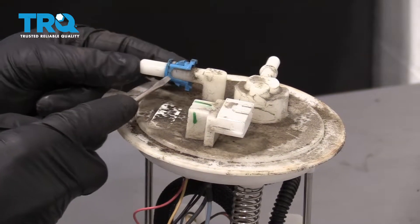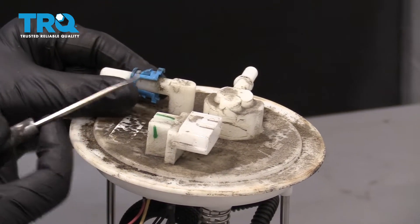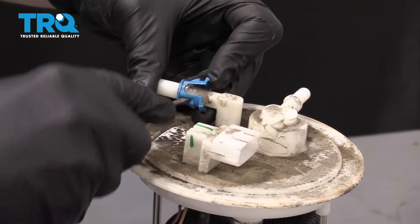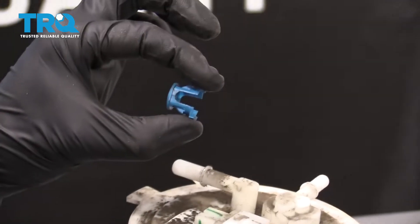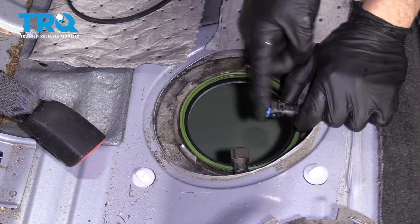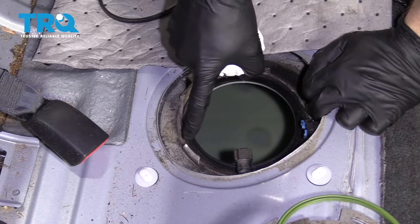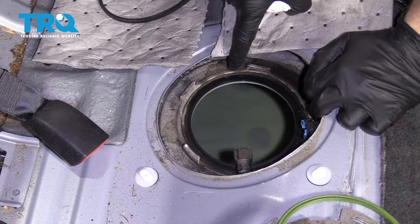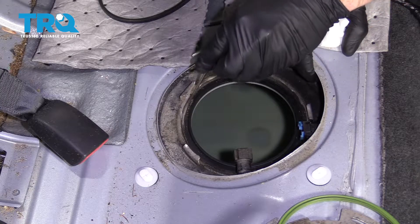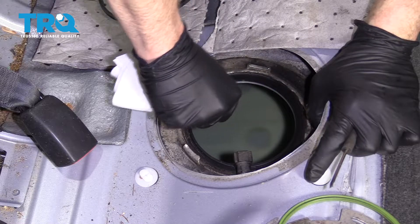It's important to make sure that if your original fuel pump came off and it still has this clip on it, this needs to go back inside that fuel line. It's very simple to take off — use a small pocket screwdriver, get right underneath this lip where one of the little tabs is, put it up over that, do the same for the other one while applying pressure and it slides right off. Let's install this onto the new fuel pump, being very careful not to drop our clip into the fuel tank. I went and grabbed a rag. We're going to take out this seal — our kit came with a brand new one, which is awesome. You want to look right along the fuel tank where that seal rides and make sure there isn't any dirt, debris, or gunk, because anything that's going to break that seal is going to be a potential issue. Let's clean it up the best we can, obviously trying not to fling anything into the fuel tank.